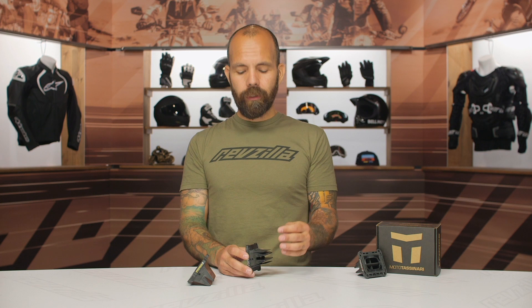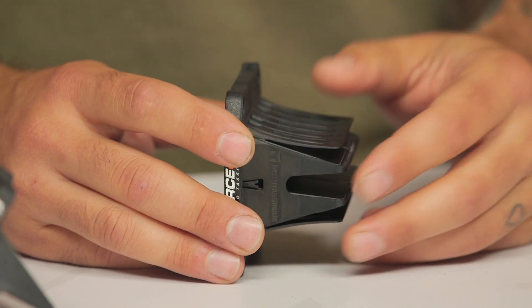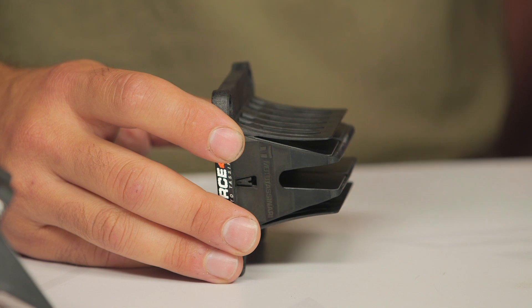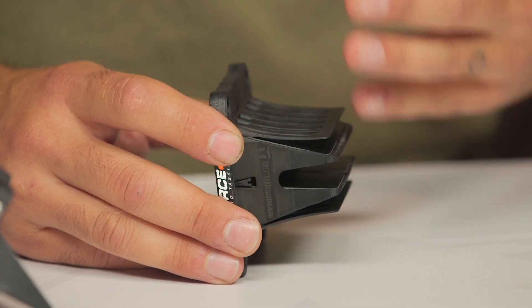As far as performance goes, the reed tip area has been increased by 10%. If you're familiar with performance modifications you would do to a four-stroke engine, like bigger valves or bigger cams, a wider area for the reed tip to allow airflow to pass through is essentially the same concept.